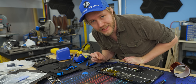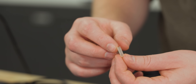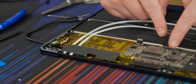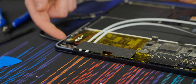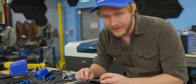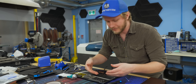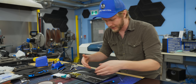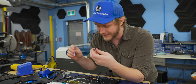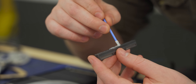Now we just need to block off the rest of that MagSafe hole using this tiny 3D printed part — very important because we're drawing air in from right here. It needs to cool the stuff on the logic board, come over, and get exhausted out here. If we still have this gap, the air just comes in there and doesn't do what it needs to do. The next thing is to put in this little TPU gasket, which prevents recirculation of our hot air — we want all of it going out instead of coming back in. But first, we need to make sure the air jets can go in here nice and tight, which means we need a little bit of vacuum lube.